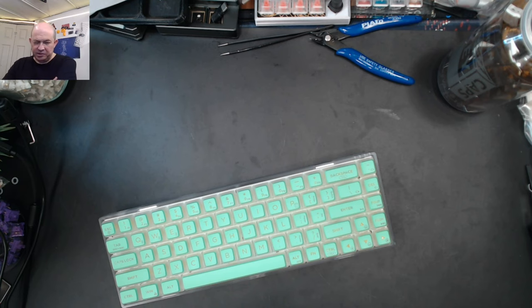I wouldn't pay more than $50-$60 for this keyboard as is, because there's just not much more life I can give to it if I can't change out the switches. Now, granted, the switches they've got don't seem awful. They're Kailh box switches, which I am just personally not a fond fan of, because anytime you open them, if you happen to pop the lid off and that little tiny button is lost, well, that switch is done.